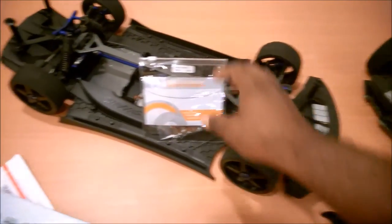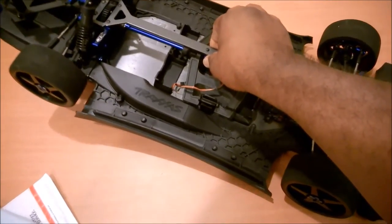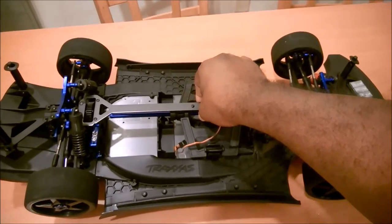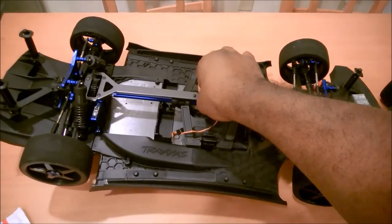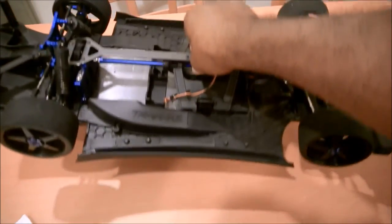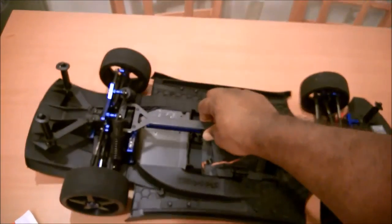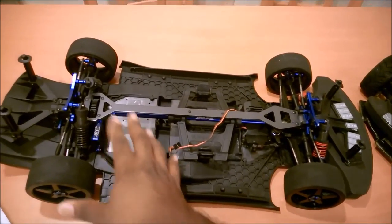But this car doesn't have a motor in it yet, but just kind of lifting it up. Well, right now it's nose heavy. Well, actually no, right now the center of gravity is right about there, which is about where you want it when the car has a full load. So the fact that the center of gravity is almost in the middle of the tires says as soon as I put the motor and ESC on, which are heavy, this thing's going to be way tail heavy. So it's probably going to be like 60-40 weight distribution, maybe even more than that.